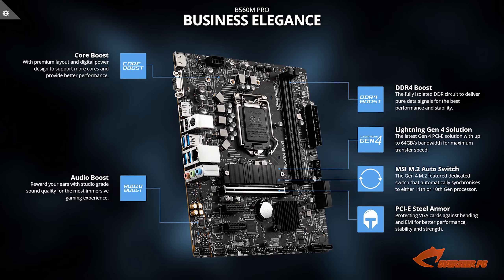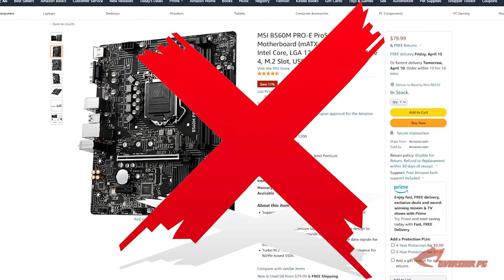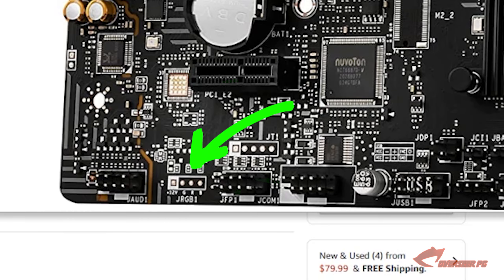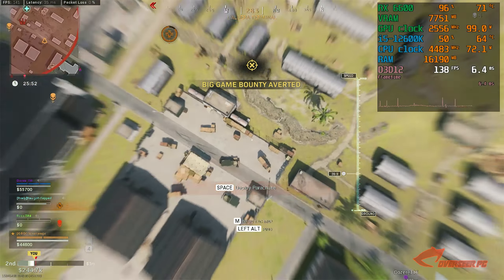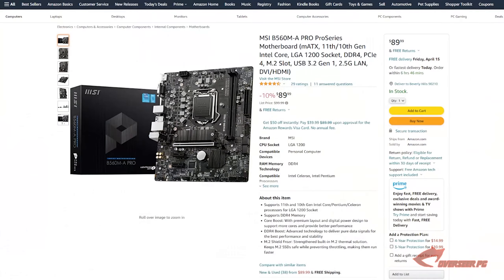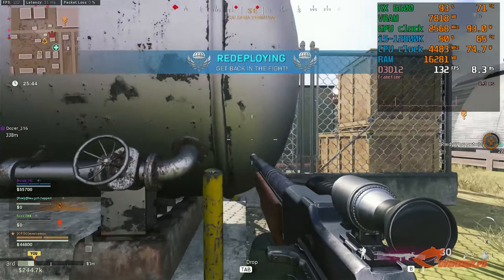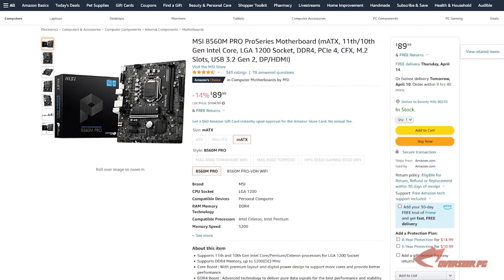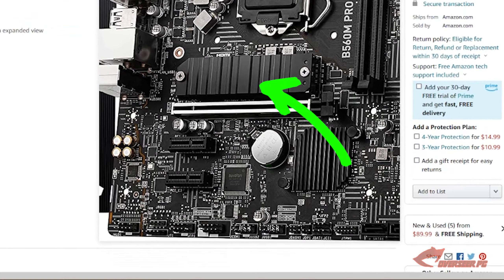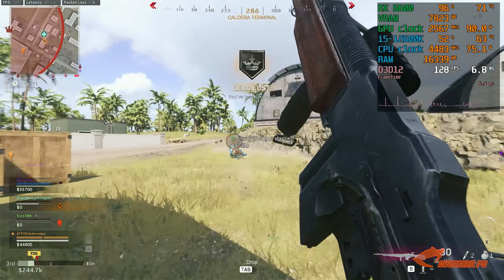For our motherboard, we're going to pick the B560 chipset — specifically the MSI B560M Pro. There are a few options but don't get confused. The B560M Pro-E at $79 — don't pick this one because it has no RGB headers: literally no 12-volt or 5-volt connectors. The B560M-A at $89 also has no RGB slots. What we really want is the B560M Pro series at $89, which comes with a heatsink on the M.2 slot and has those 12V and 5V RGB headers.